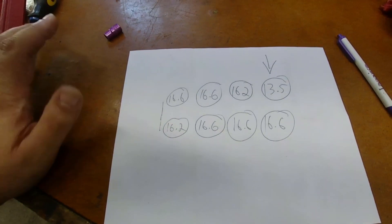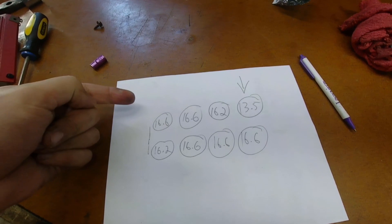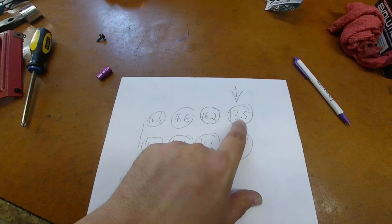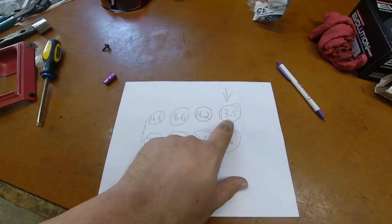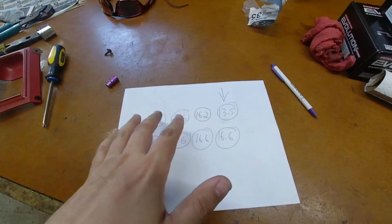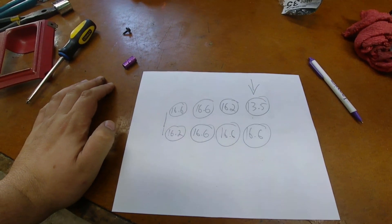Here are the readings. Here's the firewall of the car — this is the passenger side bank, this is the driver side bank. The driver side front injector read out at 13.5 ohms, so there's the culprit. What can happen is one bad injector can cause the entire bank to go bad on the engine, which might be why it's bogging and idling poorly.